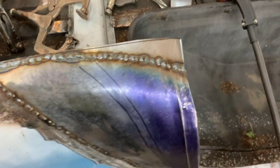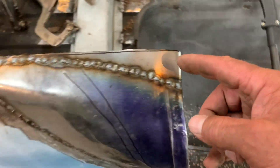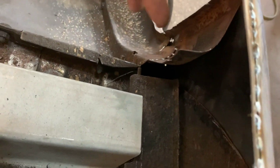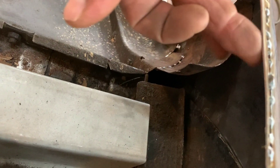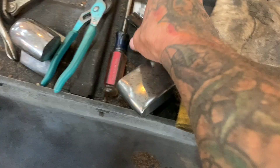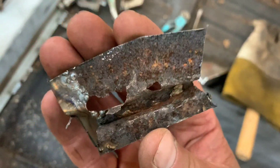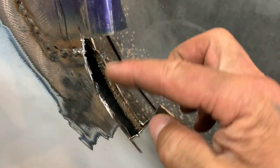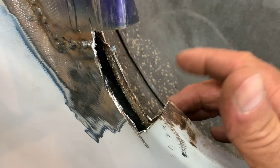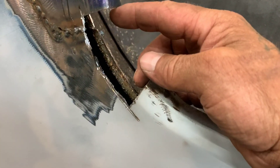There's a pinhole right there too — damn, this thing's all rotted out. Now that these match, I'll start building this piece on the inside. It stops here and needs to come all the way up and weld to this — it's kind of a brace, really strong. So I just cut all the old crappy rust out. Now I need to start building this piece — it's going to be a difficult piece because it rounds and has that body line. It's not going to be fun.